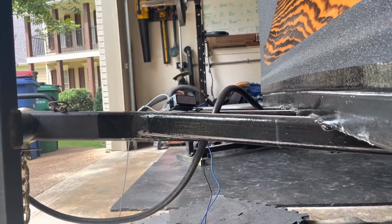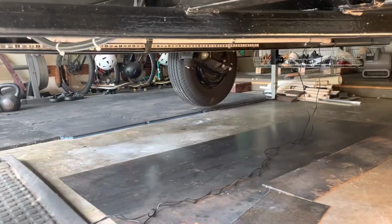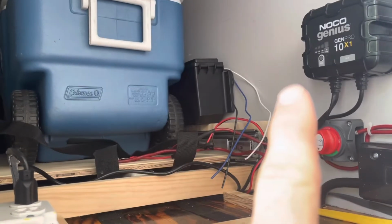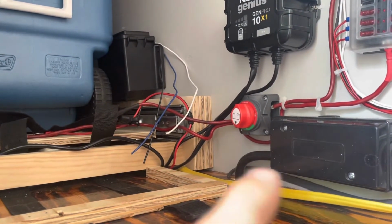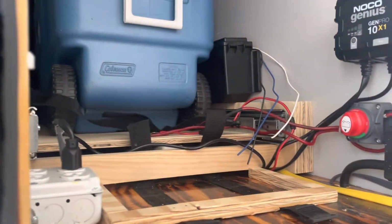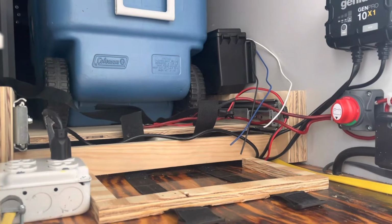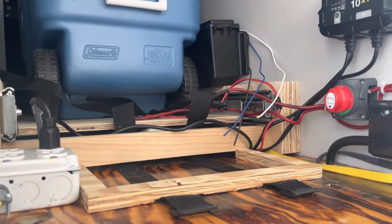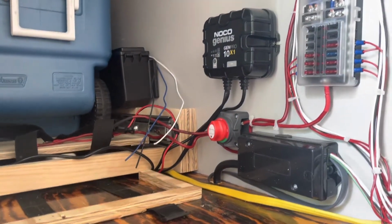Attach it to the truck, it pulls, and it'll close that circuit and then send power to the brakes. So I have to mount the battery for that, the battery backup, and then run everything into my junction box there. I'm going to do both of those at the same time and go ahead and finish building an actual battery box for the battery, cover the top up and everything, make that accessible. So little project turned into a little bit bigger.